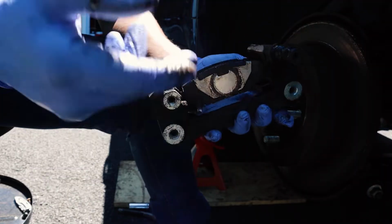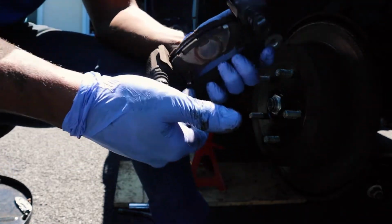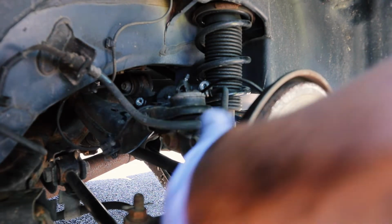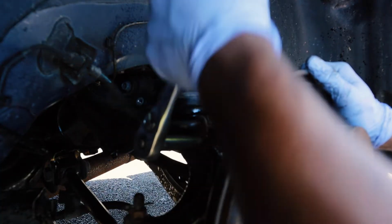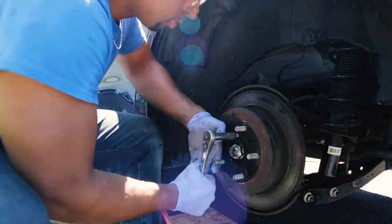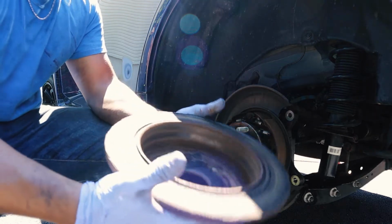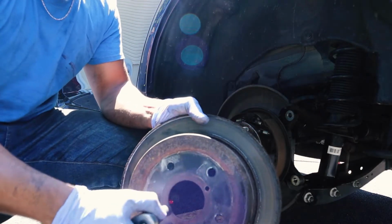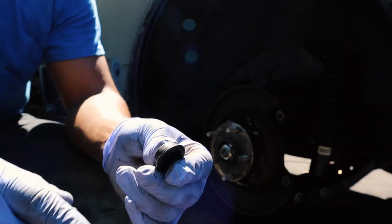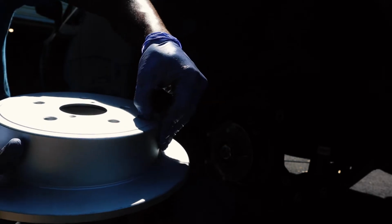And there you have it. As you can see, the rear brake pads only have one wear indicator, and that one actually goes on the back towards the bottom. Now, if you guys remember that 12 mil bolt that I told you about, it's gonna be this bolt right here. And at that point, just take it out. Make sure you remember to take that bolt out, because you're gonna need to put it back. You want to take that off of the old rotor and pop it into the new one. And it just plugs into the only hole that it really fits into.